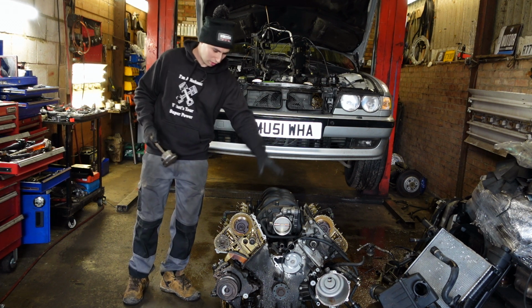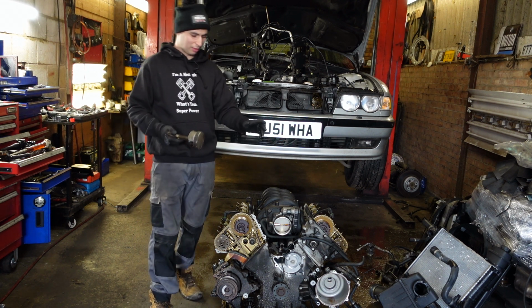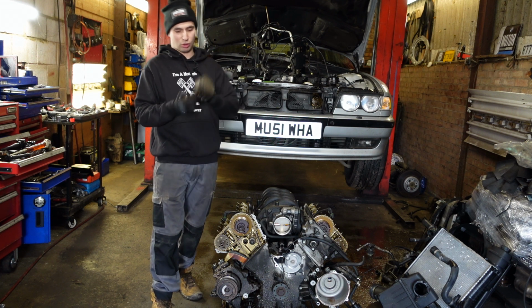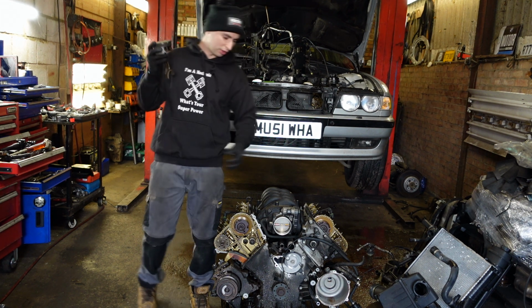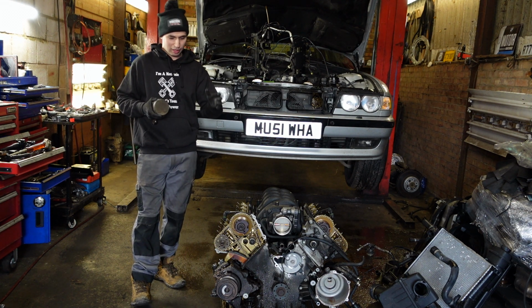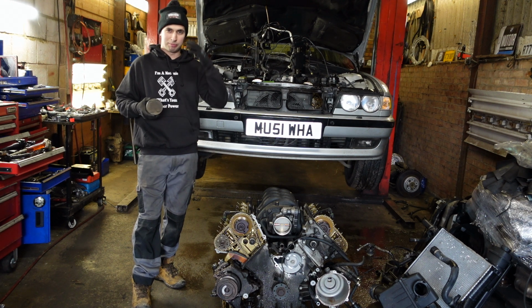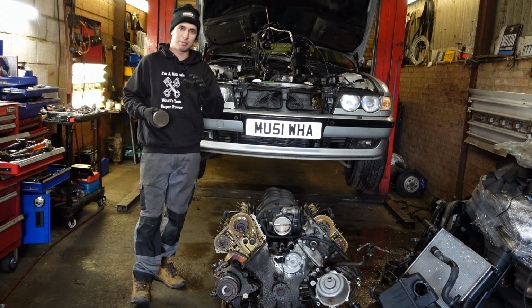This is the original engine, which, being hydrolocked, damaged the piston, probably the crank, but damaged the conrod, the weakest point. If you look at it like that, the thinnest part. So we can strip this engine down and inspect what exactly happens, so you get a clear image why you shouldn't drive through the deep puddles.